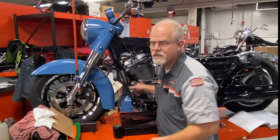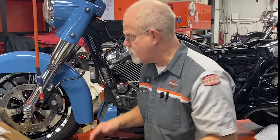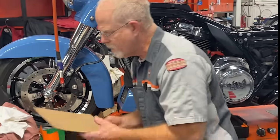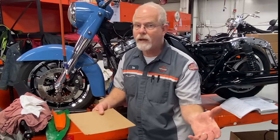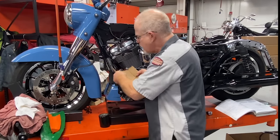How do I stop a mess? That's the big question even for experienced mechanics. The minute you take the drain plug off, you get oil everywhere, and a lot of you won't have a lift — you'll be on the jiffy stand, so it drains down. One of my simplest tips: save cardboard. When you get packages, save the cardboard because you can form it and slide it underneath.